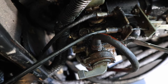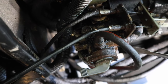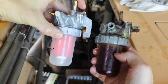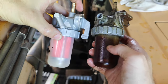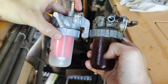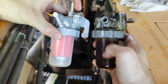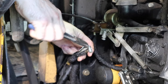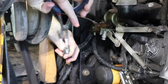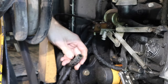Let's get this line off, pinch it off, and replace this assembly — it should be pretty fast. Take all the hoses off and if you need to replace them because they're old, do that. You can see the difference here: my old bowl is really corroded on the inside, the color has changed, and the plastic has also changed over time — it's 22 years old. Now we need to get this old fitting out of the supply hose so we can place it on the new filter.